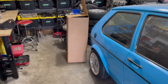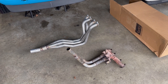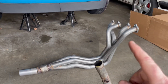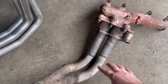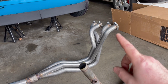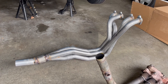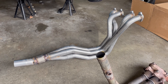One of the other cool parts we received today is probably my favorite part of this build — this long tube Mark 1 tall deck race header. It's from TT. It is an equal-length four-into-one long tube race header. You can see the original part we pulled out groups everything into two down into the downpipe. With this header, you're going to see one-and-five-eighths for each individual runner all the way back down to what I believe is about two-and-a-quarter at the collector, with a flex bend. This whole thing is manufactured in-house at TT. This is going to definitely help out the mid to top range power of this car.